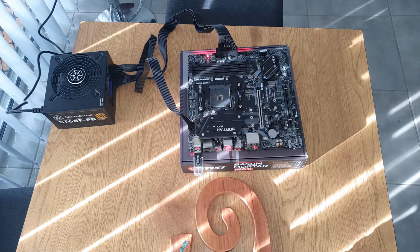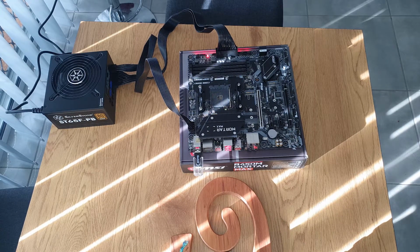Awesome. Now, one thing I do want to mention, especially if you're a new builder, is don't lay the motherboard on the plastic that it comes in. It's common practice amongst anyone that knows how to build a computer that the inside of the bag is anti-static, but the outside isn't. That static could kill your motherboard. But the motherboard box is a perfect surface to test bench your system on, for a safer environment.